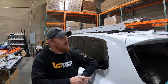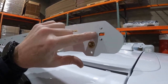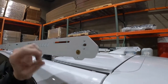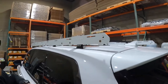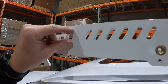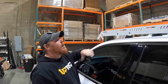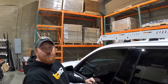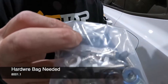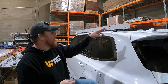For the remaining load bars into the GroovTech — you'll want a friend to help install them across the top of the vehicle so you don't damage the finish. The rear load bar needs to install vertically using the two holes — this provision allows optional quick-wire wiring to pass from the driver's side to the passenger's side. The front load bar can be mounted horizontally or vertically in any of three positions, and where it aligns, the wiring would pass through those rectangular holes. Mounting the front load bar vertically gives it more weight capacity for larger light assortments. The front and rear load bars require hardware in bag 8001.1, which has hex nuts to allow you to tighten and adjust them once the armor is installed. The front and rear load bar hardware is concealed, so use the hex hardware in those locations.